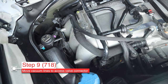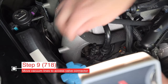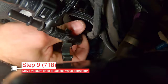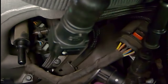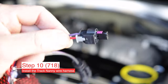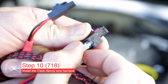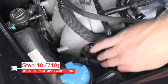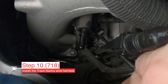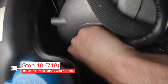There's still a vacuum line covering up the connector — it's right down here in a T shape, so we need to disconnect one more line. Grab it, pinch, and separate. Now those vacuum lines are out of the way and you can see the wired connector right there. That little gray thing is a lock — the one that came with the kit is similar. This lock snaps down to lock it in place, and you pop it up so you can pinch it off. Use a flathead screwdriver and pry it up gently so it clicks. Now reach down there and pull it out — just pinch and pull it straight up.